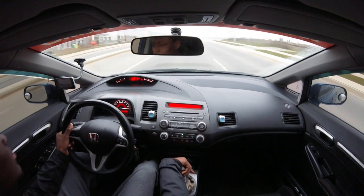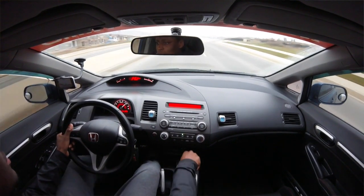My final thoughts on the spacer: for what it's worth, I really like it. During the drive, you saw me push the car to about 9,000 RPMs. I feel like with the spacer, it's going to keep your car running consistent as you push it. It's just going to keep revving all day. It's not going to bog because the overall intake temperatures are lower, so it's going to help with heat soak.